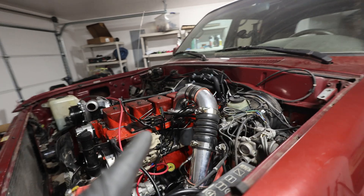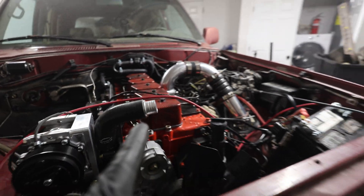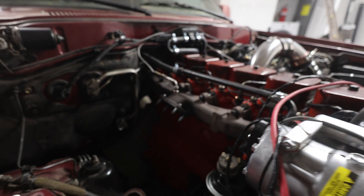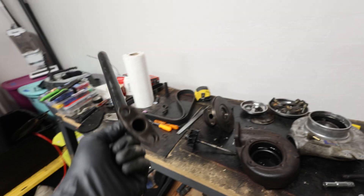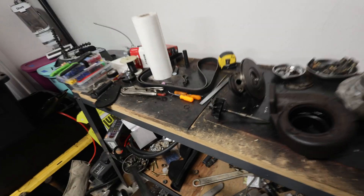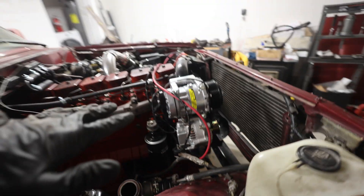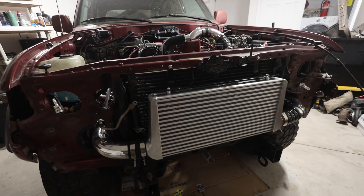If we still have blow-by after putting the turbo back together, then we have bigger issues — like did we assemble the engine correctly, or are the rings not seating properly? You're supposed to load the engine for a few hours after a rebuild to help seat the rings. I also might have an issue with the feeding and returning of the turbo — this is an HX35 and our drain pipe is off an early model Dodge, but I took a micrometer and they are the same diameter, so I don't think that's the issue. I think the issue was blow-by coming up from the block and going into the turbo housing. I also noticed a small amount of oil going into the intake, which can cause runaway. Our intercooler piping is all set though — I'm happy with the way it's routed.